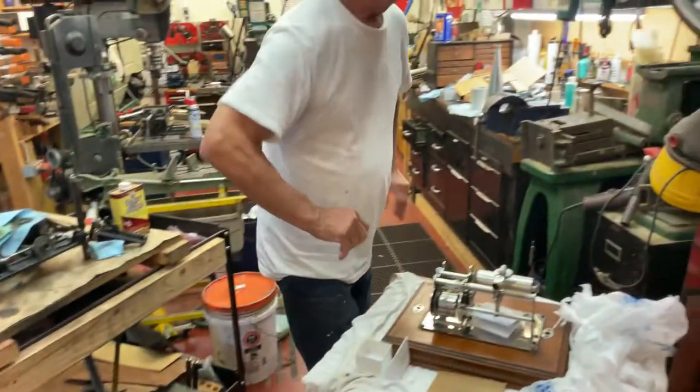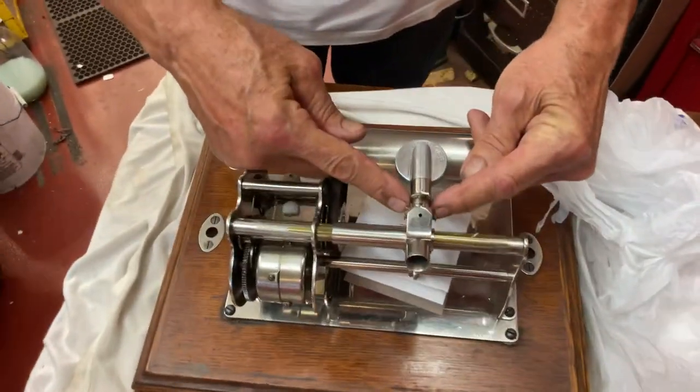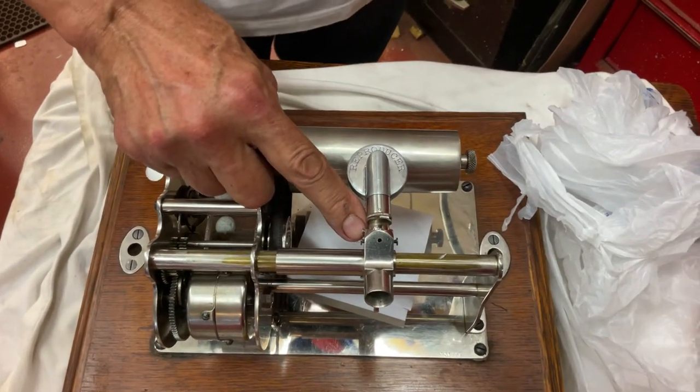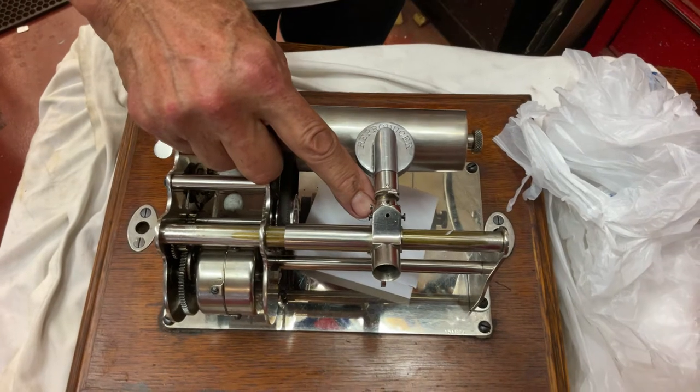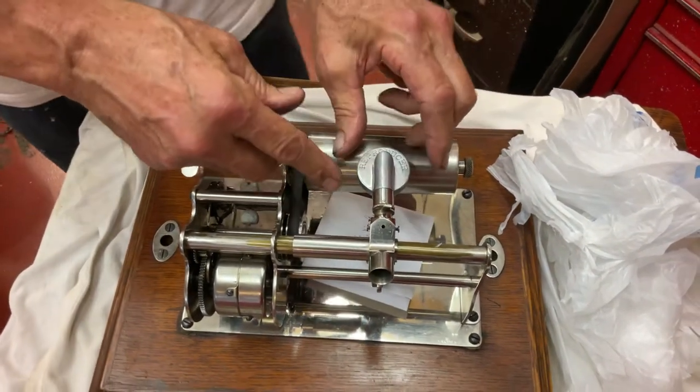The majority of people don't know how to remove and put back on a reproducer. The AB has a floating reproducer, so if you bought one on eBay and you're having it shipped to you in the United States, you have to specify how to do this, because most people seriously don't know. This reproducer has two pins in here. This is a pin I made — you can pull it out with a pair of needle-nose pliers, but I'm going to ship it with that.